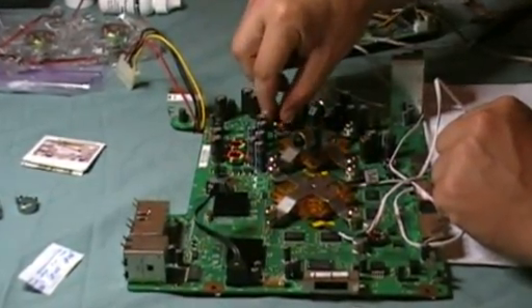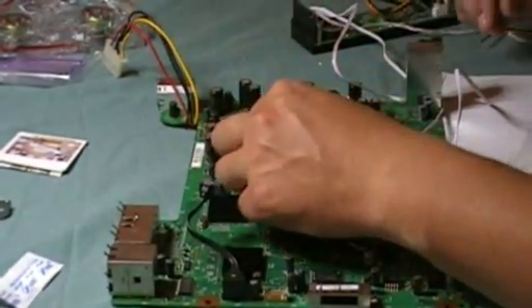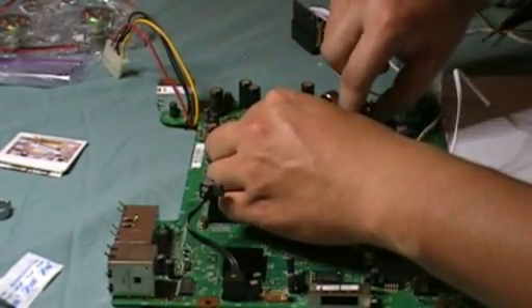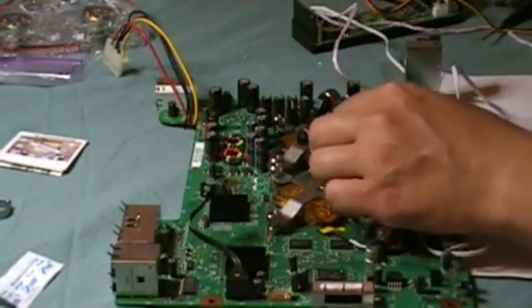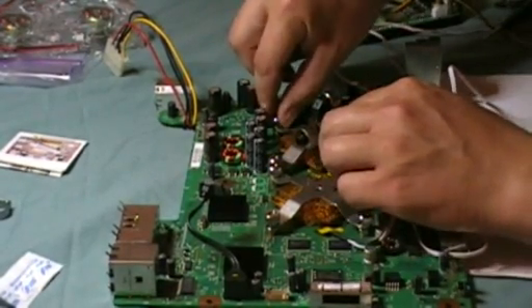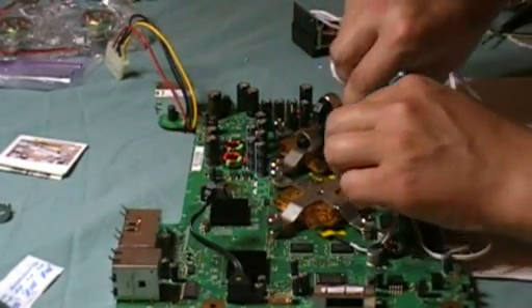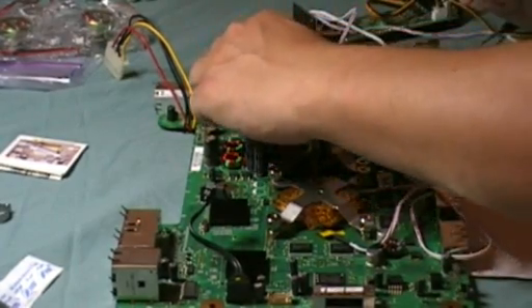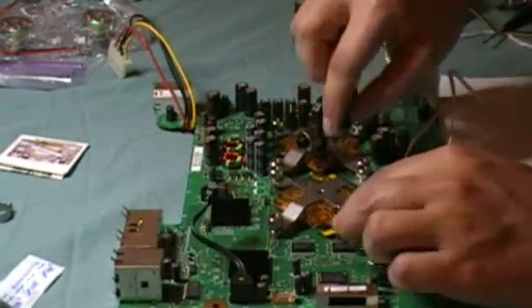Make sure you don't bend these capacitors out of the way. As you tighten, you can actually feel the spring tension here, and you'll feel the block start to tighten. Now, you don't want to break the die — that's the most important part. You just want to get it secure to where you know there's a good thermal presence, for lack of a better word. That block is definitely touching that — you can feel it.